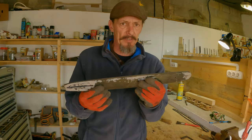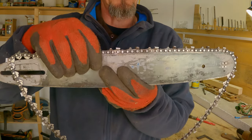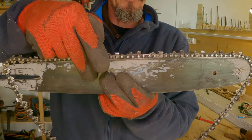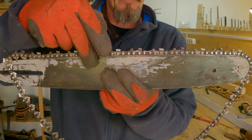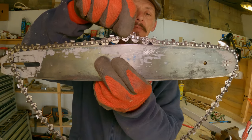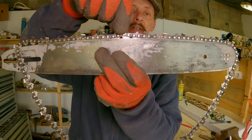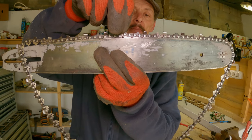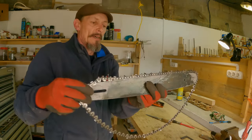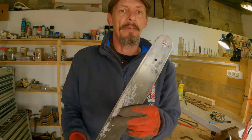You can't keep doing this repeatedly — you'll wear down the height of the bar. The bar does have a life just like the chain does. To work out if you've removed too much material, simply put the chain in it. If you've got enough height, the bottom of that tooth is not sitting in the bottom of the groove. If you had taken too much off, you'd see the chain sit so the shark's tooth bottom hits the groove floor, keeping the chain too high off the bar — that means you need a new bar. This one is doing all right; I've only done this to it twice.